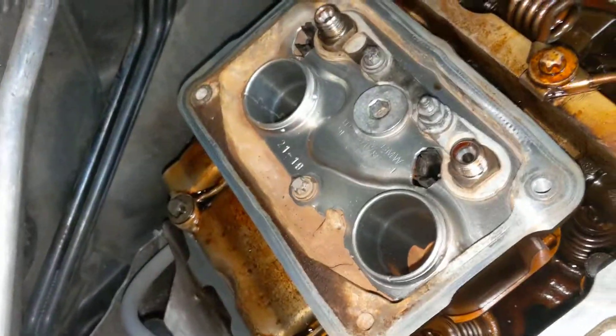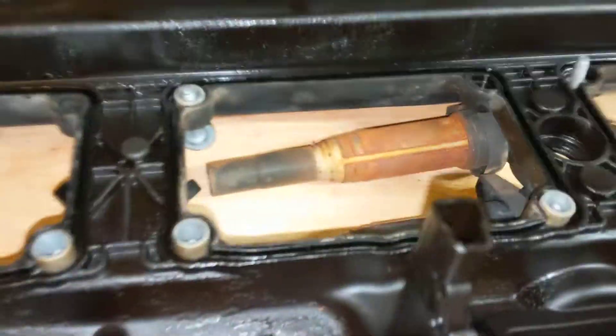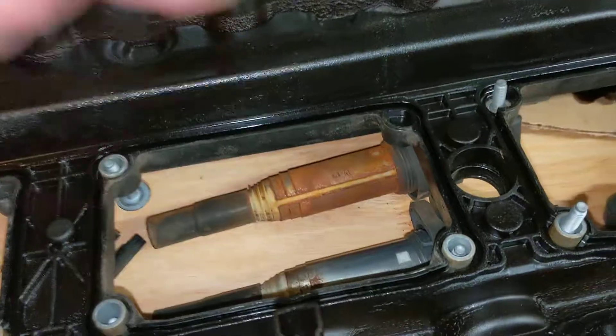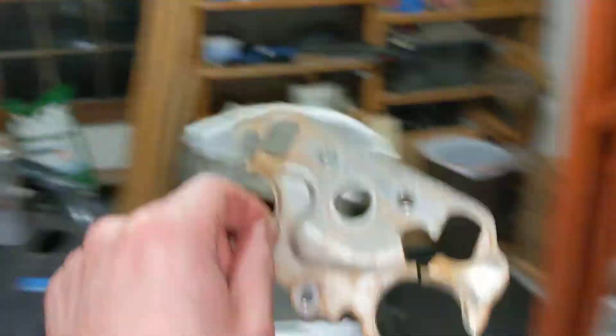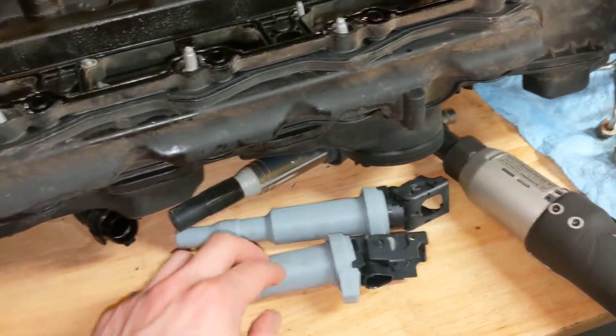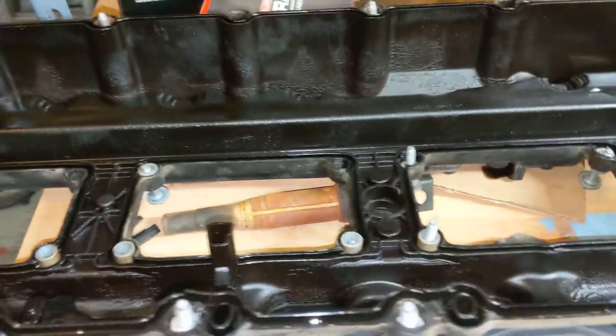You can see back here it's super rusty with some really new metal. That's because the coils look like this, but worse. The heat shields of the coils on cylinders five and six swelled up so much when I pulled them out that they took whatever this bracket is with them. Here is the trashed piece — I just ripped stuff apart trying to get it out. That was unfortunate; had to buy a new one. Going back in, I'm going to put these two Bosch coils into the five-six holes so I don't have that issue.